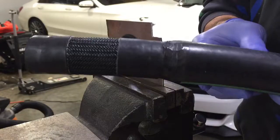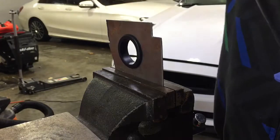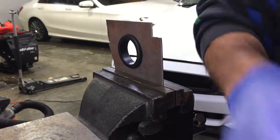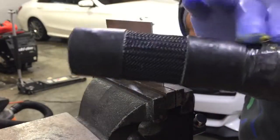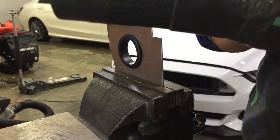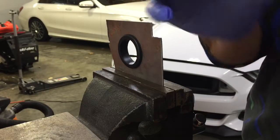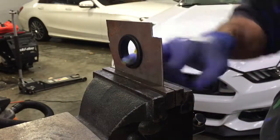What I'm going to show you is how this slides through from the inside, so you don't have to try to reach through the engine bay side with the large Kenne Bell rear inlet that comes over — it just doesn't allow you to really get good access. As usual, I like to use grease on the parts when we're trying to get these through, anytime you're pushing through a grommet or connecting the sound tube into a hose. So I'm just going to put some inside here as well.